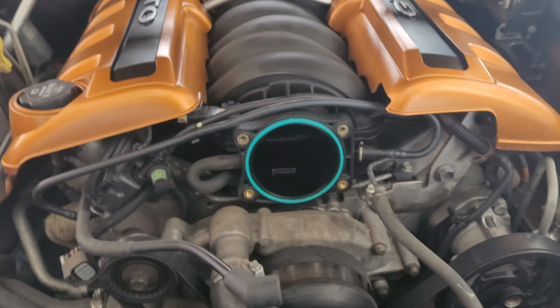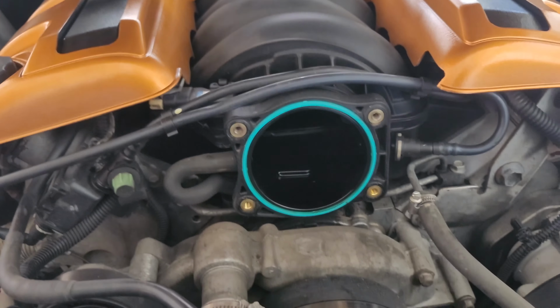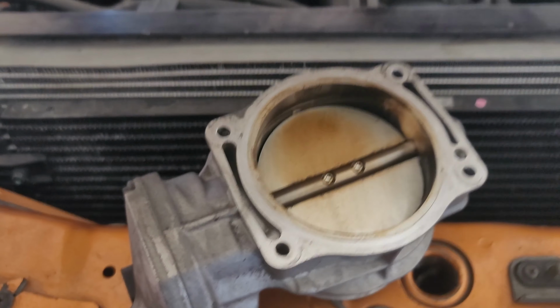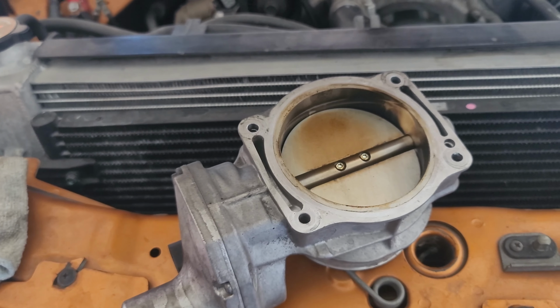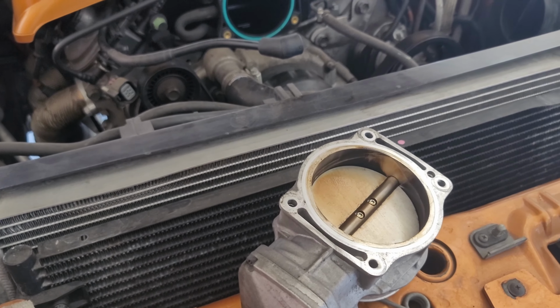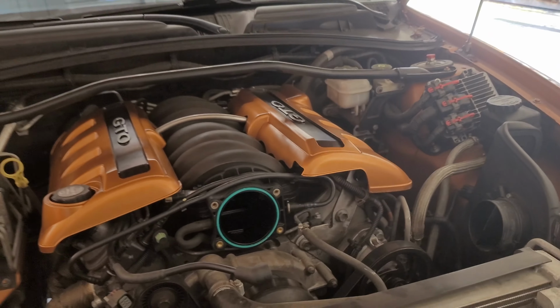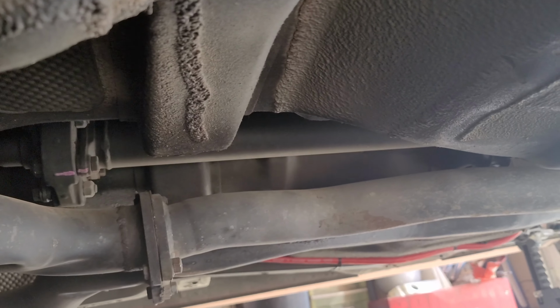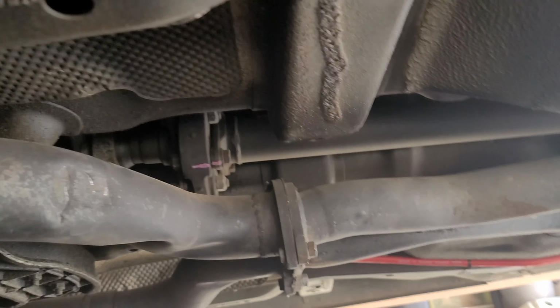What else? Oh, so back to cleaning up. Just gonna spray out the intake, clean up as far as I can reach in there, clean up the throttle body, which is, ooh, that's a good thing. Stock, these are only 92 millimeters. The Fast 102 is 102 millimeters. That's a big gap. So if we're talking about doing heads, cam, intake and upgrading to 500 horsepower, there's something under here that ain't gonna jive.